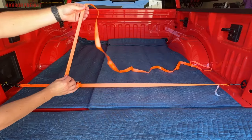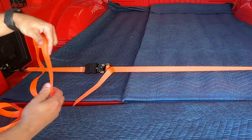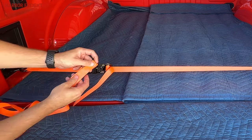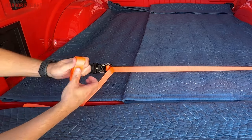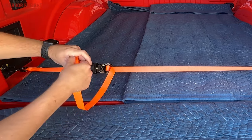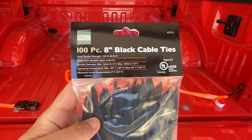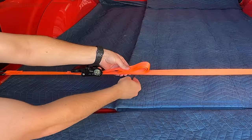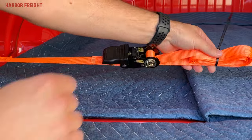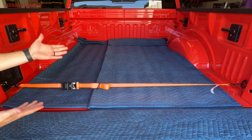The only other thing to do is take care of the loose webbing, also called a dog ear, as it can cause legal and safety issues. Turn the webbing over itself and wind it up neatly. It doesn't have to be absolutely perfect, but get the extra webbing in a single orderly location. Then use a zip tie — you can get a hundred-pack for a couple bucks at Harbor Freight — to securely lock it down so it won't go anywhere while transporting. You are now ready to travel.